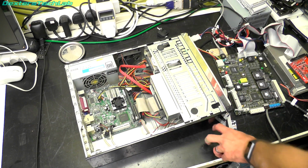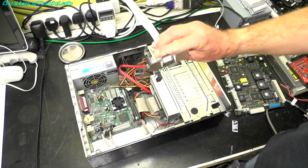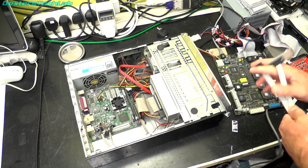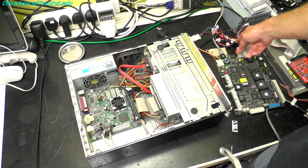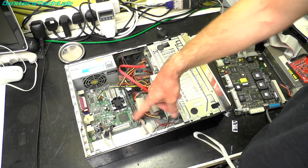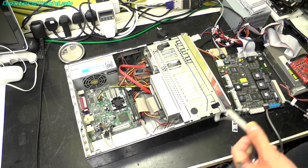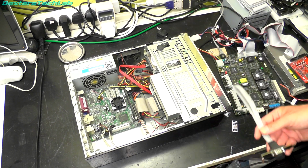There's a few other little bits. There's a serial port on the Netcom board which I would like to have accessible, so I have a little small riser there for fitting it into the back plate, and I can just wire this in to the board. There's possibly some other better solutions going down the line. Given I've actually got network coming into this box, there's no reason why I couldn't have a very small little network switch inside here and actually have an RS-232 to TCP/IP converter to give me a telnet interface, and I can just telnet into it and not have a serial port. So that's probably something for the future though. We'll stick with serial for the time being because it just works.